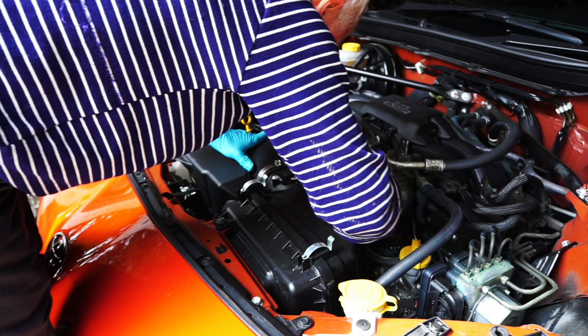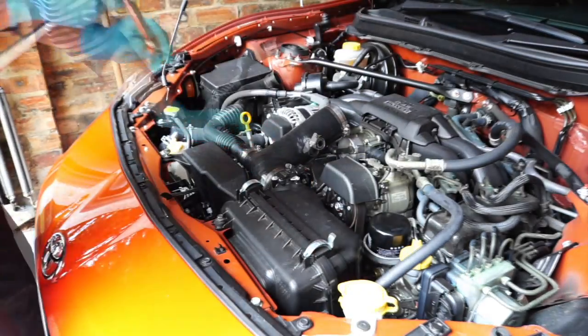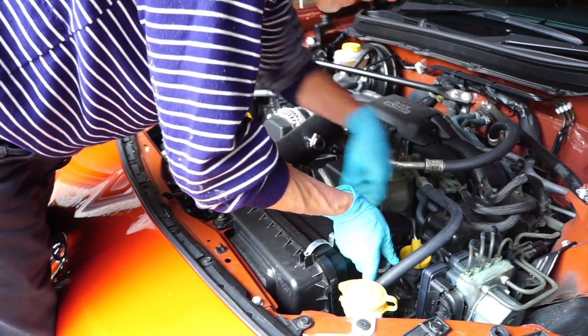Okay, this is where you realise that the silicone inlet doesn't have the flexibility of the stock inlet, which is great for better airflow in the silicone inlet, but much harder for the install. However, the easy solution is to remove the bolts holding the air filter and inlet chambers. This gives you enough play to fit the silicone inlets, especially after lubricating them on the inside edge with a little detergent.